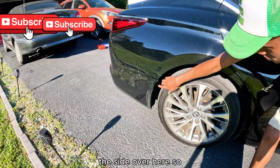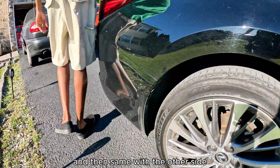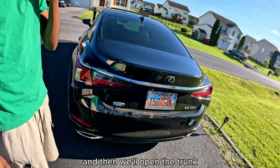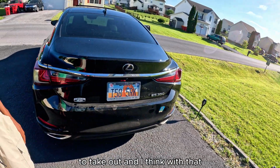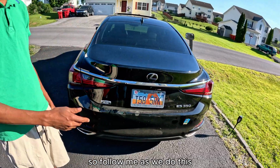So we have clips on the side over here, so we have like 2 or 3 clips on this side that you need to take off, and then same with the other side. There's 2 or 3 more clips on the other side, and then we'll open the trunk, and there's 2 bolts on either side that we need to take out, and I think with that we can just take off the bumper. So follow me as we do this.